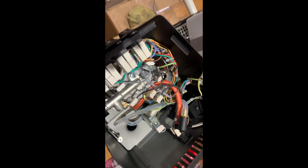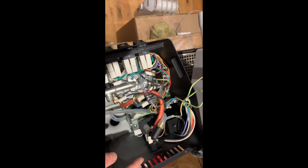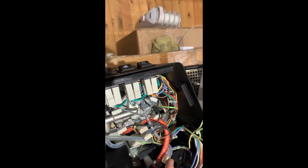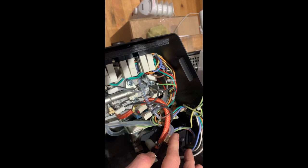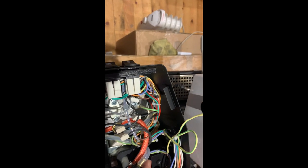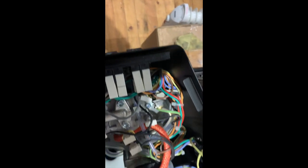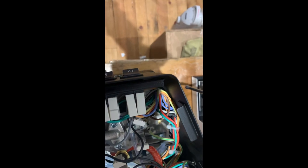The good news for people who modify these machines is the inside looks pretty much identical. We've got the OPV here, which is where you install the nine-bar or six-bar spring — whichever you want. The switches are all the same, we've got the same pump. In fact everything looks the same apart from right down at the bottom where you'll see the group head, which is now golden, whereas before that wasn't the case.